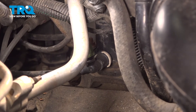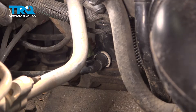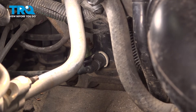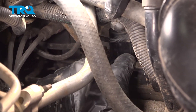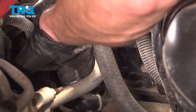Now we can start disconnecting the EVAP line that leads to it. That has the green cover up along the top there. Looking at the connector, you can see that it does have a white locking tab. To disconnect it, press in along the side, press it towards the opposite side of the connector, and you should be able to slide this off. Squeeze along the side, push that in, and then slide it out of place. Quick inspection to make sure it's not damaged, and set that aside as well.